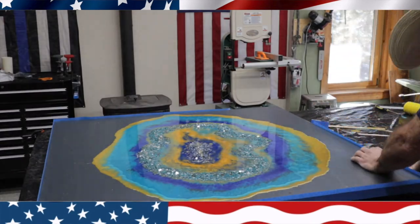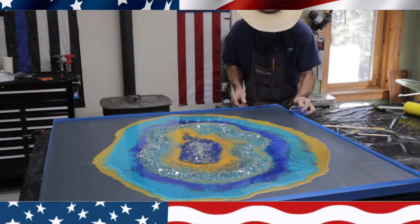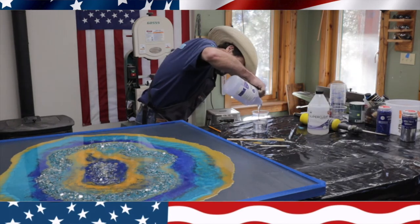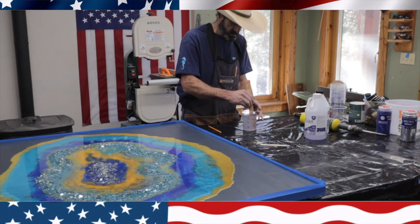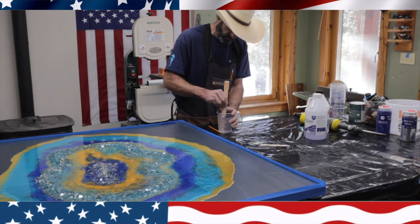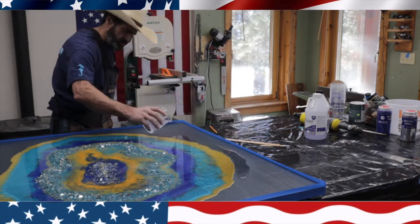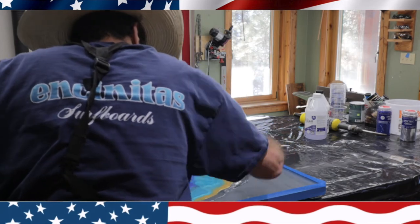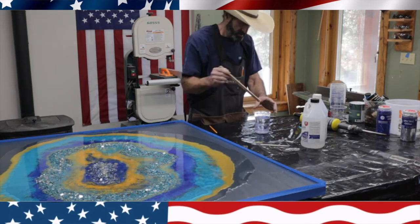That's what I got done on day one. On day two, another thing I learned is you don't need to sand — the next day you can come right in, throw some clear down, and start blending right into the outside edge. If you look closely you can see all the colors blending really nicely. This is my favorite one so far. Everything I learned on the first three projects I put into this fourth one. Adding clear all the way around the outside edge allows me to blow other colors right across the existing color — like blowing right across that gold.